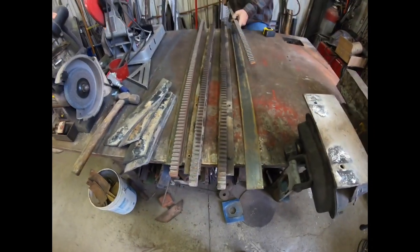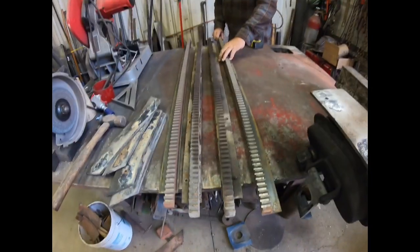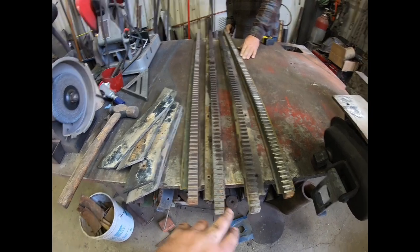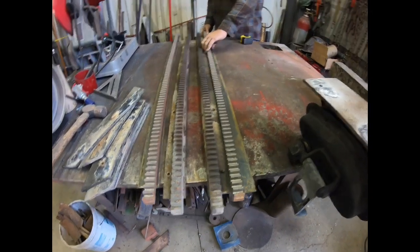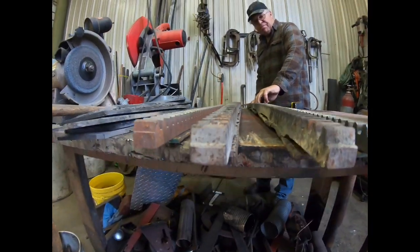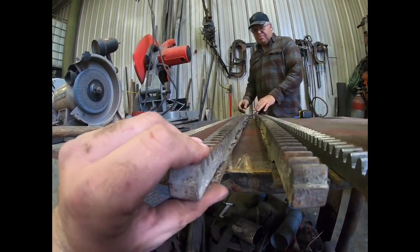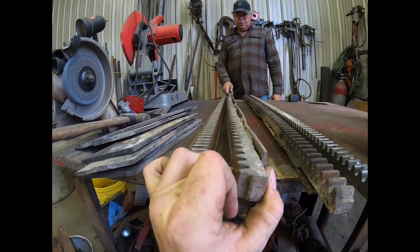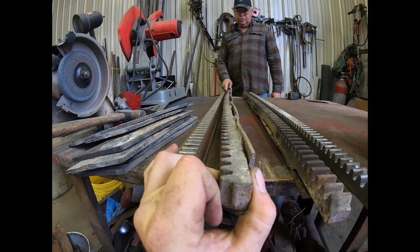It's very important to lay these out on a welding table the exact way that they go on the doors, and to match everything up perfectly so that when they go back together they're right. As you can see with them laying on the welding table, you can actually see how bowed they are. Turn them on their side — that's why that door was so stiff to open.